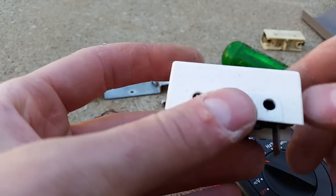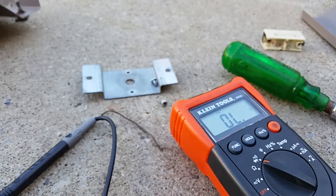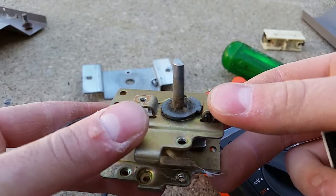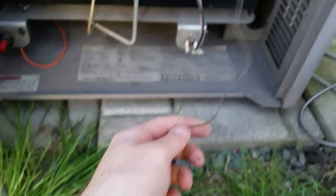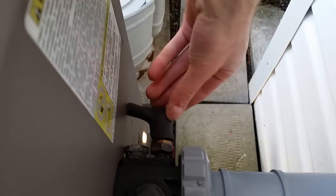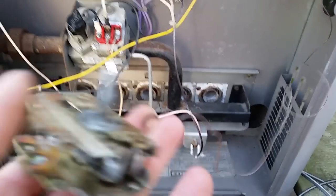You just take one out and put it where the other one was, and that's how you can service your thermostat limiter switch without having to mess with this little guy here - whether you're stuck trying to get it out, or putting in a brand new one if you have a spare part. If you have to start pulling panels off to trace this wire here, which is the contact wire where the probe must be somewhere back here on the pipe. This is the other limiter switch, by the way - should your water ever get to boiling point, which is unlikely with a pool but maybe a spa, if the water can get dangerously hot, that'll kick in. If you don't want to mess with that and you just need to change that switch because you need a spare part, that's how you do it.